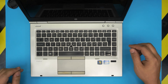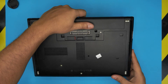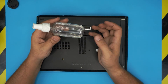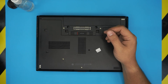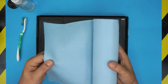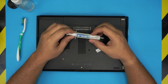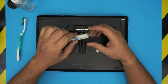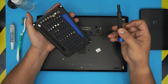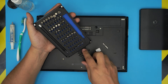First thing first, you want to power off the laptop and flip it upside down. I'm going to go over the tools I'll be using: isopropyl alcohol 95% or higher, an old or new toothbrush, one sheet of workshop towel, and your favorite thermal paste — for this one I'm going with Arctic MX-4, though MX-5 is fine too. You'll need a screwdriver set; I'm using an iFixit set as they have one of the best bits — S2 class steel, which means they'll last many years. We're going to use a Phillips number zero.